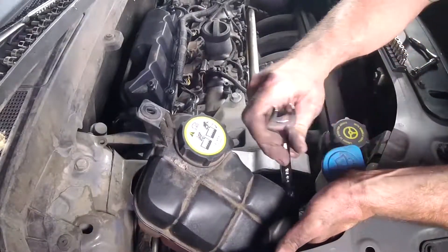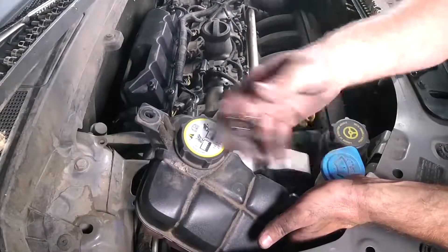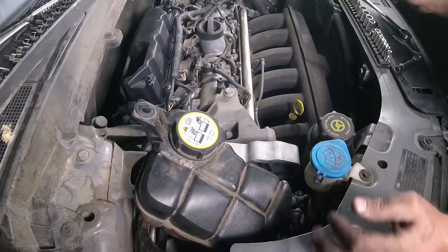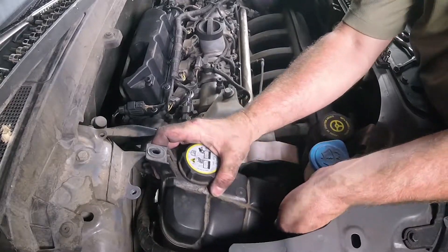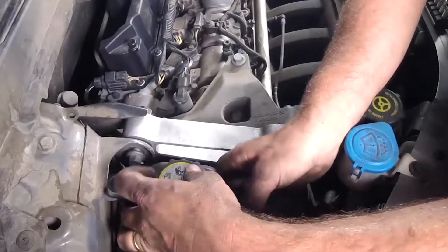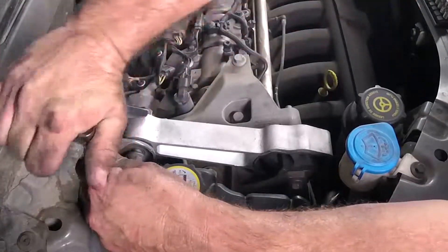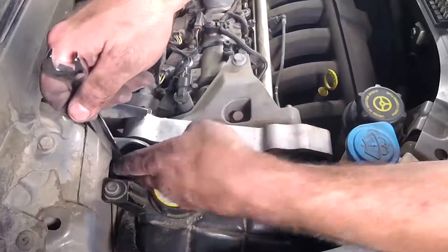Back to our 15mm wrench, and it's threading in just like it's supposed to. Finally I can see the bolt beginning to come through on the other side. That thing was in there pretty tight, so I really cranked it down pretty hard. Now our overflow reservoir can go back where we pulled it from — you just need to make sure that you hit that retaining clip. And our 10mm bolt goes back in. That takes care of that. Now back to the 15mm wrench, and I'll finish tightening this side.